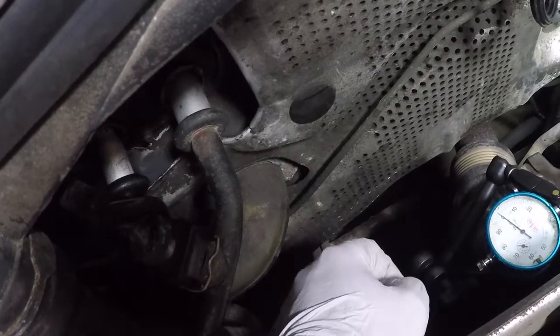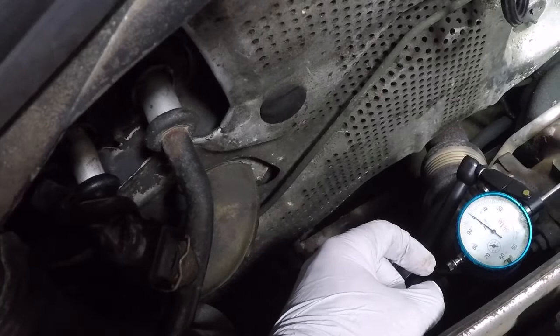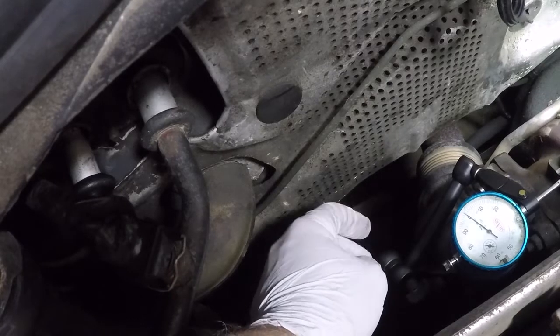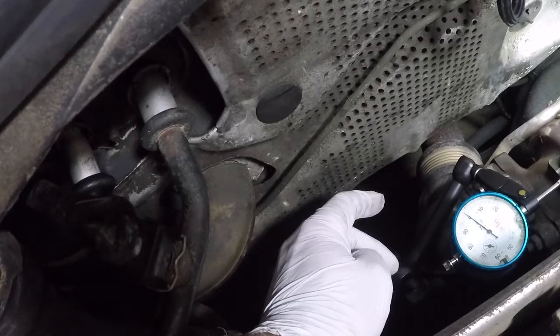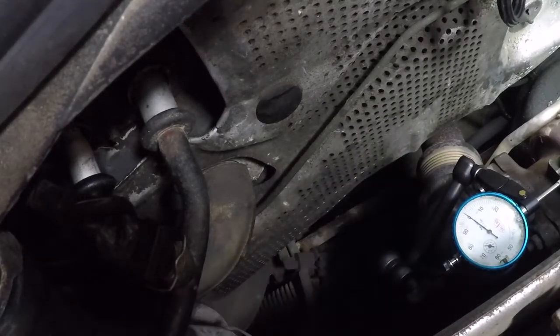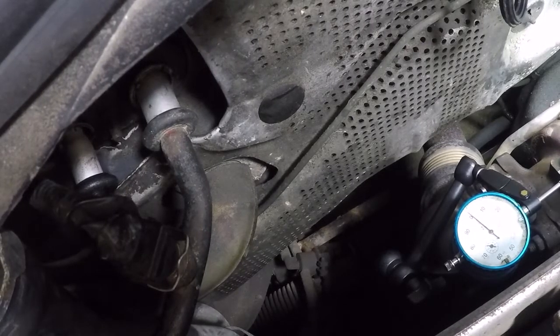What I've done here is I've set up at great personal expense a Noga dial indicator — it's a Noga holder down there. It has to reach all the way down; the only good metallic surface I could find was the half shaft. So it's up, bent around, twisted, shaken in a lot of different directions, but it should give us a good indication of what's really going on visually. Because to be able to see that arm move is highly subjective and very difficult to see. Let's apply pressure to the wastegate actuator.